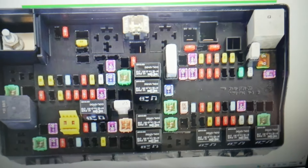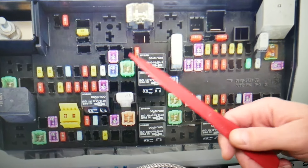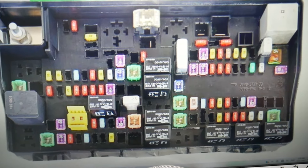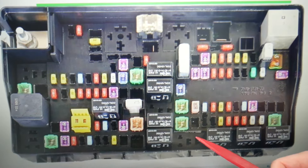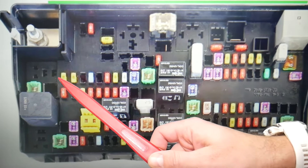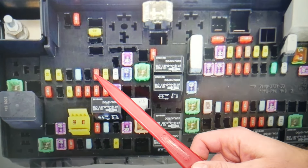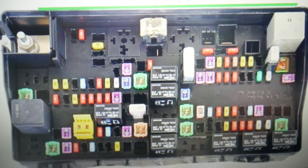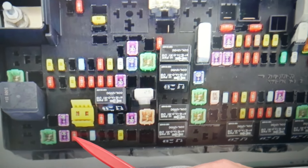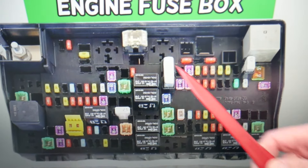You have multiple relays, but unfortunately you do not have a relay — you have a relay fuse. There are two of them you need to check. Counting this way: 57, 58, 59, 60, 61, 62 — fuse number 62 is one of them. The second fuse you will need to check is fuse number 99, right here. Both of those need to be checked for the AC clutch.